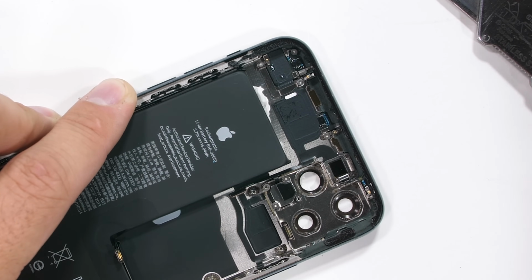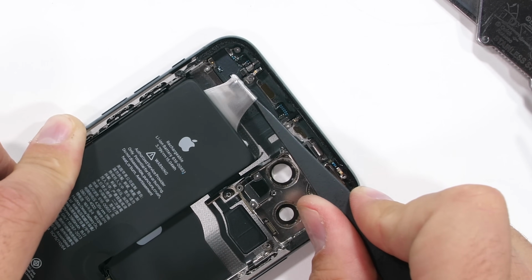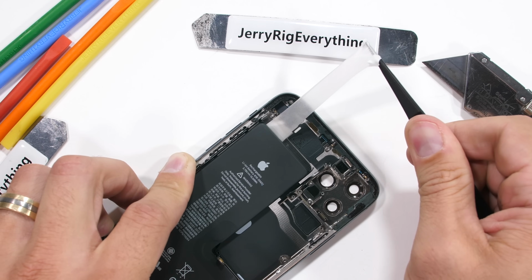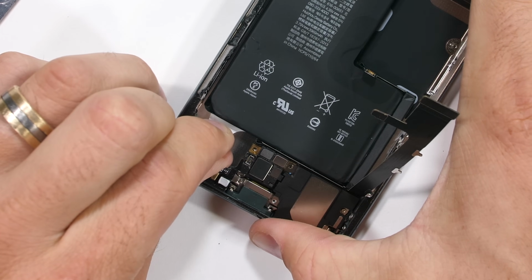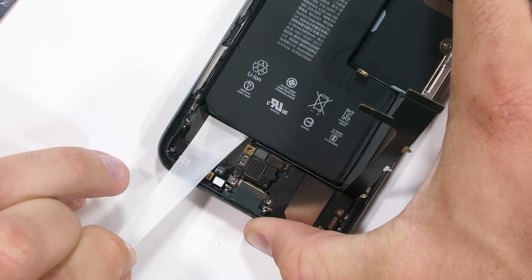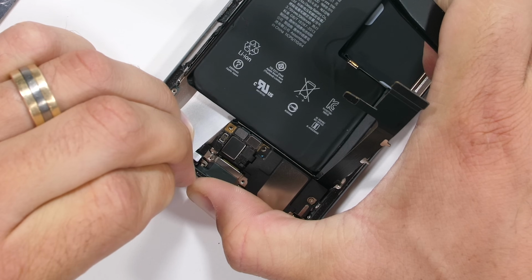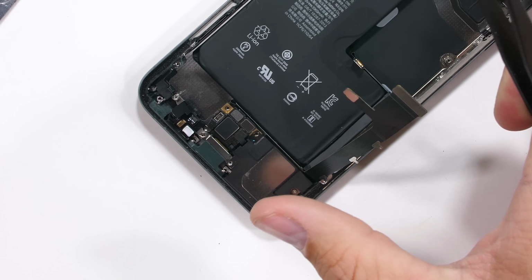Yeah, they are still pretty fragile and break every now and then, but it's still much better than what Samsung is currently doing with the permanent adhesive in their phones. Apple has 3 pull strips at the end of each side of the battery. And I was successful enough with most of them that the rest of the battery can be lifted up unharmed.